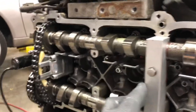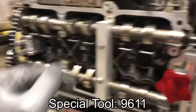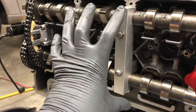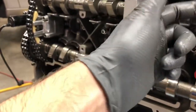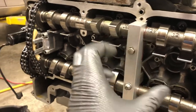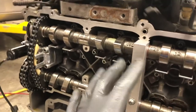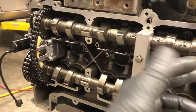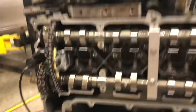There's the special tool — I'll flash the tool number up on the screen. This particular tool is meant to hold the cams down and make sure the cams are seated in their journals. I put plenty of assembly lube onto this so that we're not putting any score marks onto the cam while it's in place.